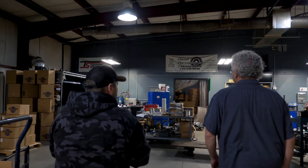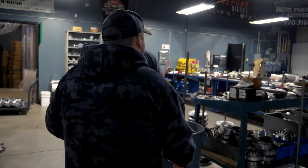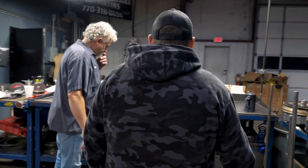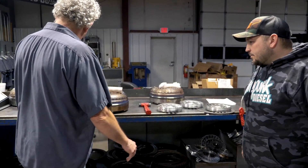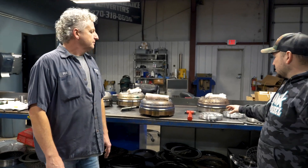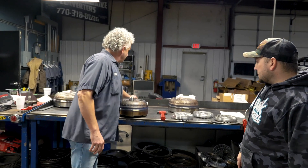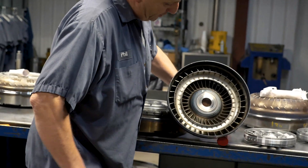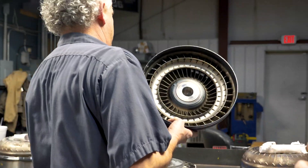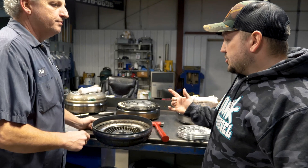This is the assembly area. Right now he's doing some refreshes on some things. We do different modifications depending on whatever stall you want. That's basically stall speeds — changing the stator or a different pump. You see this pump here — that's basically a neutral pump. Let's give the guys a quick crash course of how the fluid runs in a torque converter and what changes stall speeds.